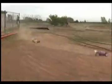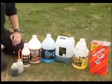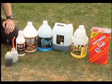The fuel you put through your engine will determine its power characteristics. Several manufacturers have got different blends of oil, different fuel combinations, different nitro content. You can get anything from 10% right up to 50% nitro content, but you'll have to shim your engine accordingly to make it get the best from that fuel.